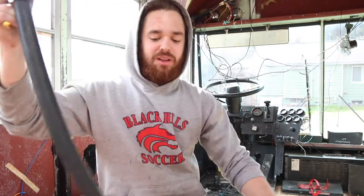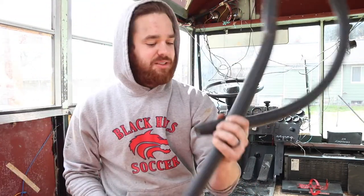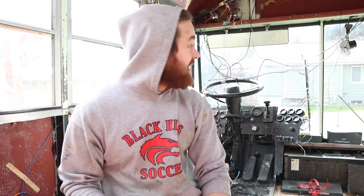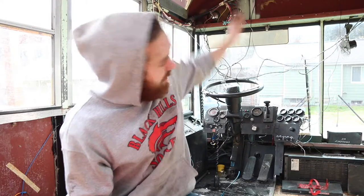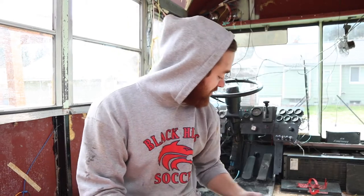What's up guys? Welcome back to another installment of the Schooley School Bus Conversion. Today I decided we are going to do the coolant lines — we're going to rerun them under the bus. The reasoning for this is because I need to defrost the whole front windshield. I was going to get an electric one, but the interwebs decided that was a bad idea because there's so much window that a regular car defroster can't do it. So I saved all my coolant lines originally, which is awesome, and I saved all these fittings. I'm going to try to piece everything back together.